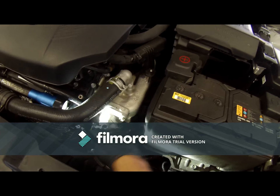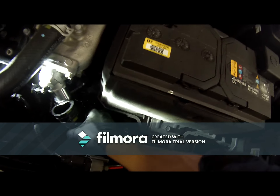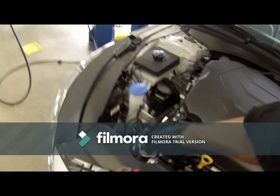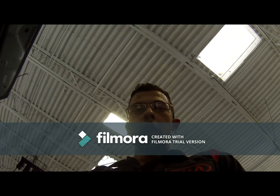Obviously make sure the three bolts are tightened up properly like they should be. Then go ahead and slide your hose back on, put your clamp back on. Obviously take off your radiator cap right here — it no longer has any pressure in it because it was all released.